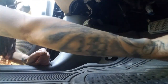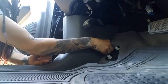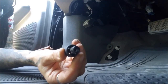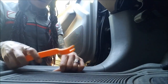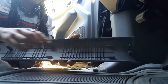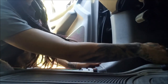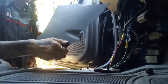We're going to start by pulling off the footrest, and then there's just this plastic nut which you can just remove by hand. Next we're going to want to pull up this panel — you just take a tool like this and really just run it anywhere along, whatever makes sense for you to pull it up from. It's a series of clips, so just pull as hard as you can and then this piece is going to come off. Where we had our nut before, push forward on it and it pops off like that.